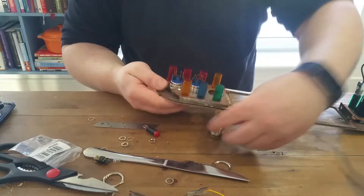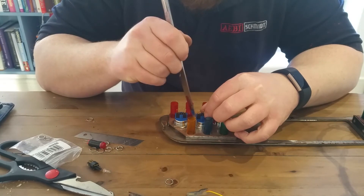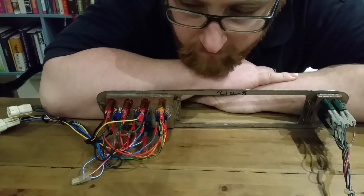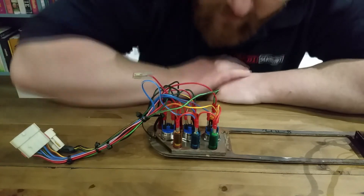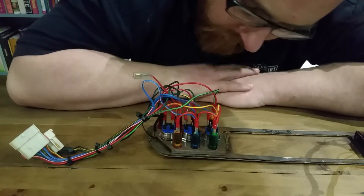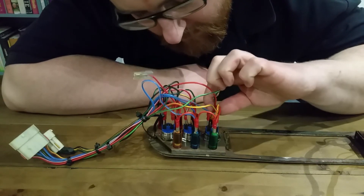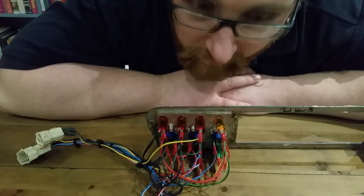As is so often the case, a simple button repair has become a full dash rewire. We're now upgrading all the original filament warning lamps to LED. The three original buttons are also taking a walk, replaced with stainless steel push buttons, which will not only look better but also grip the back panel to the fascia, thus solving the original issue. We've used the original wiring wherever possible just to keep the colours right in the loom. We've trimmed off the original larger female blade terminals and put on smaller ones to suit the new switch gear and LEDs. The glue is in and dried, and now it's all sitting terminated up looking rather lovely. Somewhat nervously, it's time to see if it's going to work.